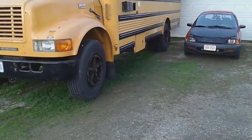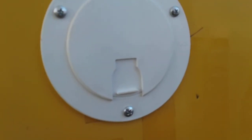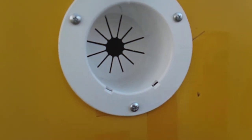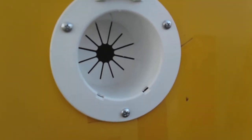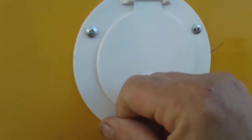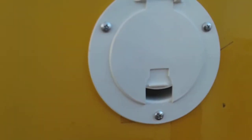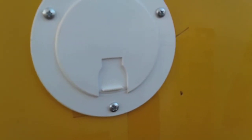Let me show you something. I've got a little bit of stuff done. I added this hatch here for an electrical cord. In my case, if I ever need to run a cord into the bus, it'll just be to run a battery charger. Mostly I'll probably use this to run a cord from my power inverter outside the bus in case I'm working outside and need 110 volt. You put your cord through, close it up, and the cord goes through there. You can adjust that as needed. I don't have it sealed in yet, but we're going to do that real soon.